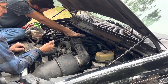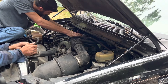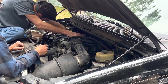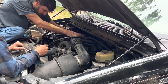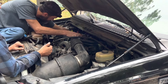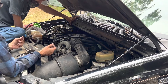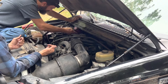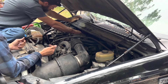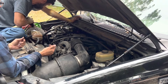It's good that you know people. And like I said, because I knew those plugs and coil packs were so new, in my brain I'm like, nah, it can't be that. But here we go. And that's what usually trips you up — thinking that because it was new, it can't go bad. Where I was just aggravated when the Mark 8 started misfiring. I just changed the plugs and cords. It ended up being the coil packs — generic coil packs. I put three of the OEM ones back in, which only had 83,000 miles, and it works fine.